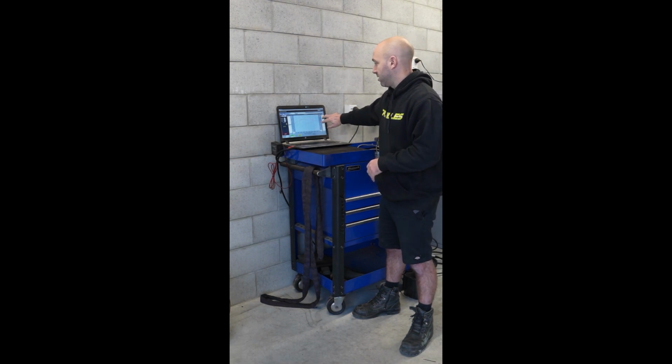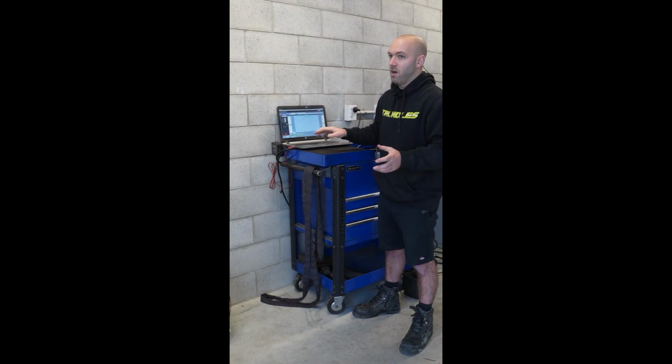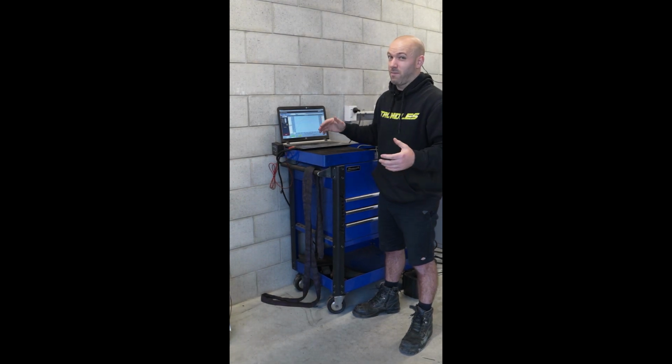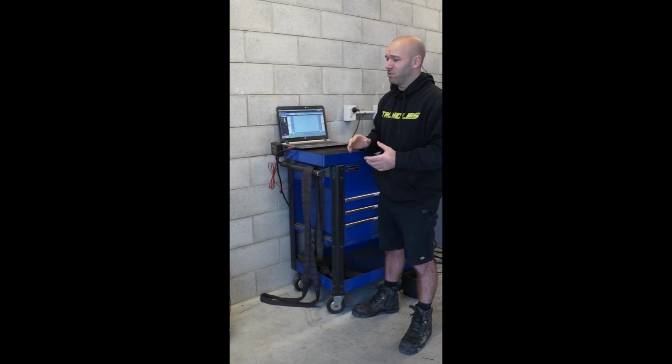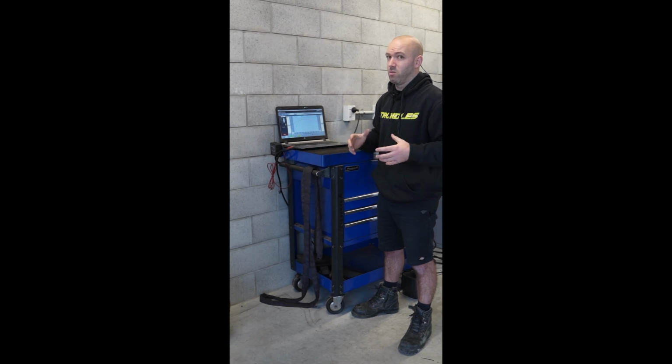However, the boost is around 4.5 to 5 pounds less, and our total horsepower is very close. So I believe that if we ran 13 pound flat in the top end, it would probably make the exact same power figure. I'll show you where the power is, and keep in mind we were only chasing 450 horse with this setup. It was more about response, but I'm pretty impressed.